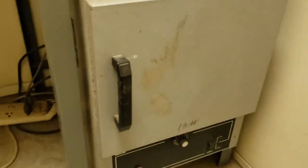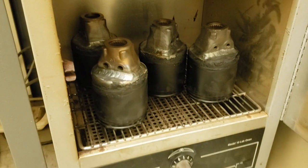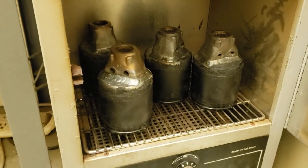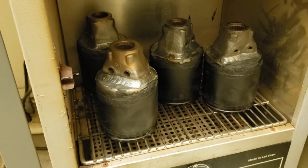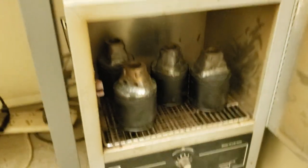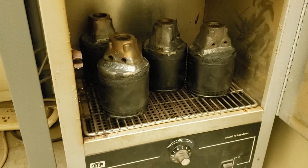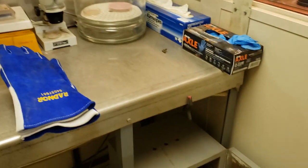Here in the lab we have a little oven. We heat the cups at 350–400°F and let them go for a couple of hours to make sure they're good and hot. These have already been welded and are actually cooling down — we'll pop those out, glass bead them, and send them for heat treating. Our axles are done and we'll be good to go.